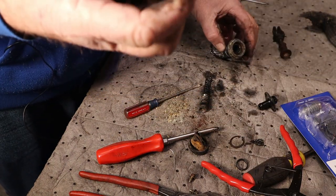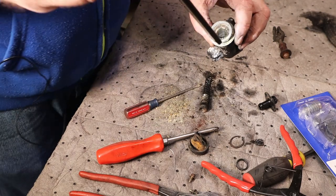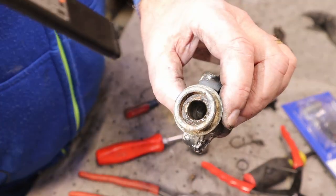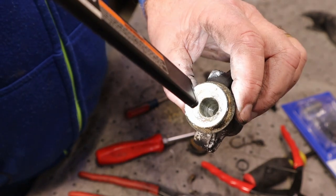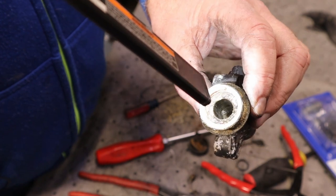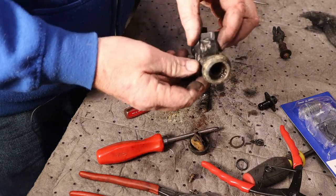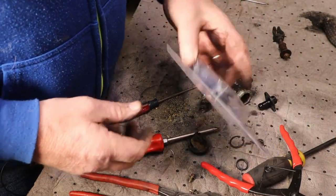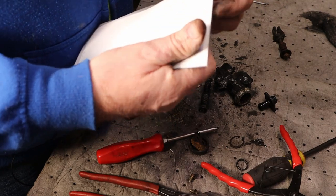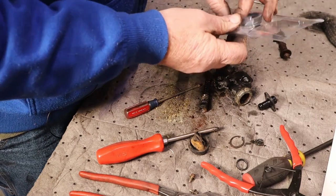You'll never be able to see this, but I will. The bore looks pretty good. That doesn't look too bad, so we just need to clean all this up and then we'll use our new parts to reassemble it. Rebuilding these master cylinders really isn't that hard if you have the fuel tank off your motorcycle so you can get to it easy enough.